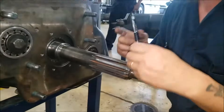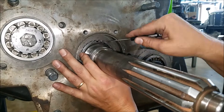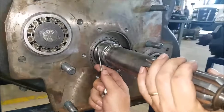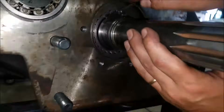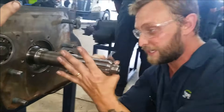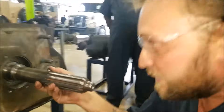Remember, trusty big deal snap-on tool — get it in there. There's a groove back here behind these teeth, probably about a sixteenth of an inch back there. When you do this, you want to make sure that snap ring is completely in place. It's going to hold your shaft perpendicular to the engine — you don't want it being all messed up because it's going to break stuff, and that's just bad. So we got that one in there.